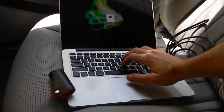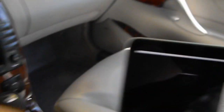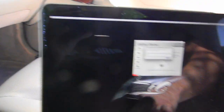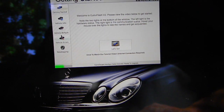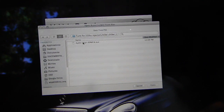Basically all we do is log in. So this is the program itself. If you plug in the flash tuner cable to the OBD2 port — come over here — the computer and the car are now connected and communicating. What we can do here is use your administrator password. Now you look down — this is the interface. You can see the cable has been detected. We're going to go to vehicle reflash and select the file. Here it is, my custom tune.